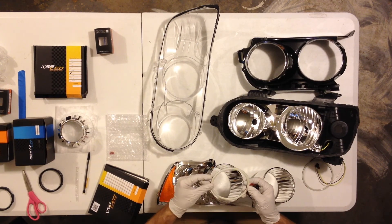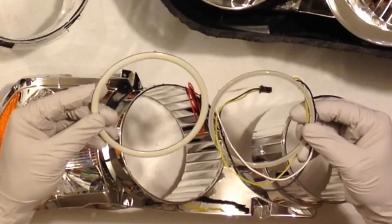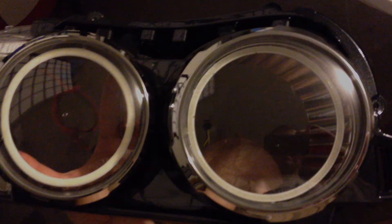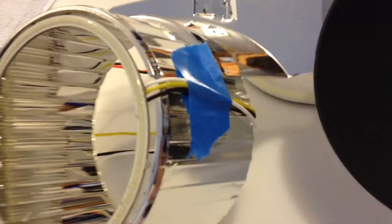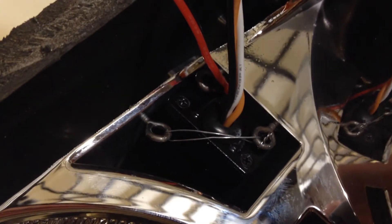After that lovely demonstration, what exactly is the downside of this whole system? It's the halos. The halos, although they are the same manufacturer, same brand, and same revision number, are not identical — and it was only a matter of size. The 110mm and the 120mm use different LEDs, and they also use a different wiring system, being that one uses two wires and one uses three. I believe that also means the driver that senses whether you're in turn signal or DRL mode also functions differently. I'll show you in a brief slow-motion video that there's actually a difference in timing between the two.